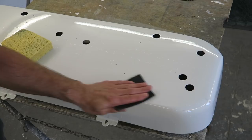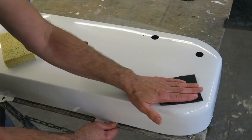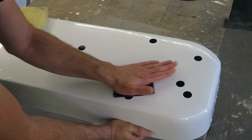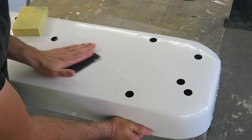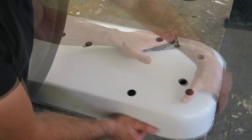I don't know the product, I don't know what it's made out of or anything like that. The only thing I frowned about a little bit was they made quite a few references to it being applicable to any surface, including bare steel, without any primer whatsoever. I just wonder how well it actually sticks to bare steel, unless it's got similar etching properties to etch primer, or mechanical bonding properties like epoxy. I don't know.